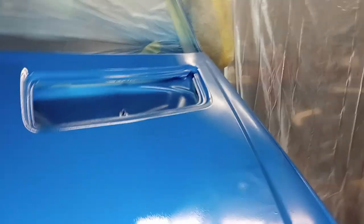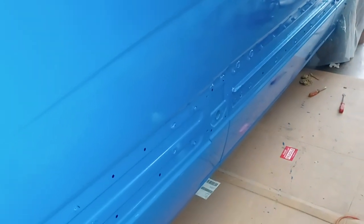The second coat I did another four cups. I had some problems with orange peel on the hood, but that was a problem with getting my gun set up correctly. Once my gun was working better, I had way better luck. I think I could, without any mistakes, do this whole van with less than a gallon. I still have a cup or two of paint left for touch-up.